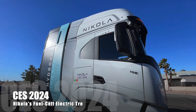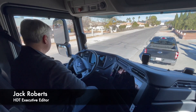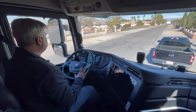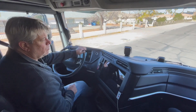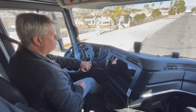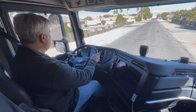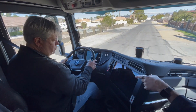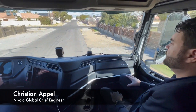And that's it and off you go. You can hear the fuel cells are starting up again because we're in drive, but you don't need to worry about that. Our energy management control system, which we develop all in-house, is managing all of the energy and power flows in the background. The right lever is where you can adjust the levels of regeneration, so you can play around with that while you're in drive.